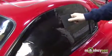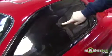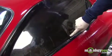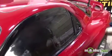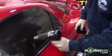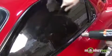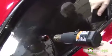Now with your hard card, you'll want to anchor down the existing film by putting pressure from the top and middle along the left and right hand sides. You're going to be creating what is called in the industry as fingers. These fingers can be problematic if we don't address them. So with your heat gun, we're actually going to be wet heating the actual film. Notice how the film itself begins to curl and create little slight S's in the actual film. You'll want to run your heat gun over those.